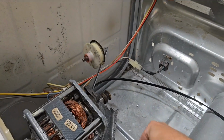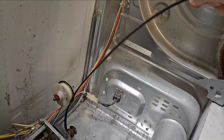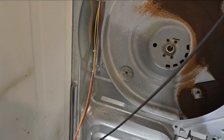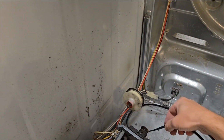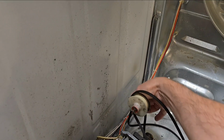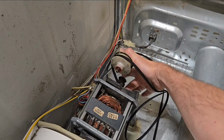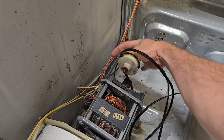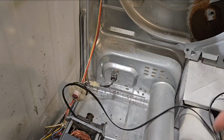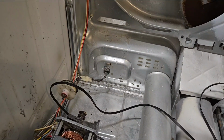You have to then put the belt again on. So what's happening here is the belt runs right here on the motor around the drum, and I don't have enough hands there, and this one needs to go around like that as a detentioner, while that one goes straight up to the drum, and somewhere around here is the tensioner running. So the belt kind of goes like this, and the other one goes up there to the drum. Hope that makes sense. Once a drum is in there, it will be a little bit easier. Not to show, but to figure things out.